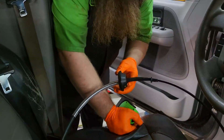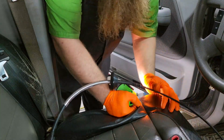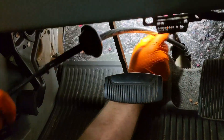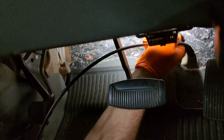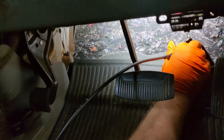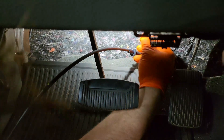We've got our new cable. There's nothing to swap over — it comes with new grommets and basically everything you need. We're going to fish this back through the firewall first and then run it up to the steering column. We can shove the grommet all the way through and then pull it back, and you'll hear it kind of pop into place.